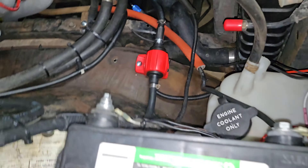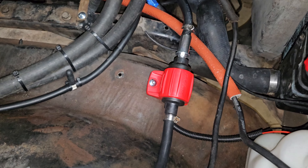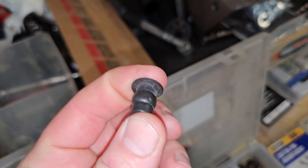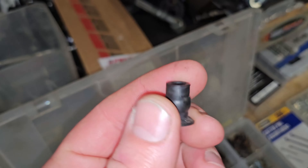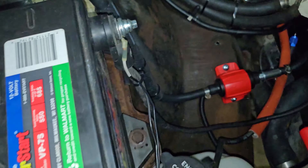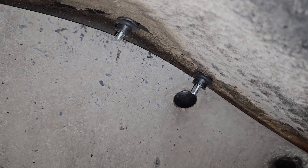I was going to run just a single fuel line from here to the nipple on the hard line that comes up the frame. Fun fact — the nuts on this are actually from a windscreen on a motorcycle. This is kind of like an anchor in a wall: the more you tighten it, the harder it squishes. You can see where the nut is in the rubber, but it has all that space that collapses and stays tight. I used to do motorcycle mechanics, so I have a lot of leftovers — and a lot of shiny bolts too. You get these started and then they tighten up like so. If you have any of those leftovers laying around, they're handy for something like this.